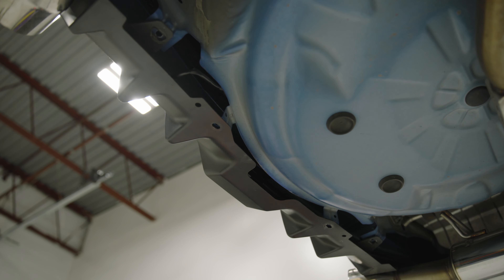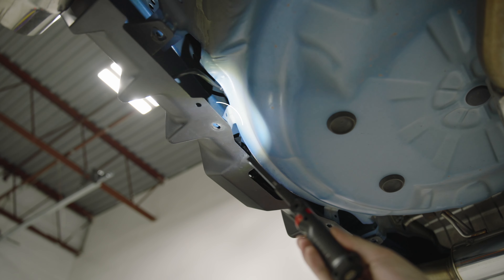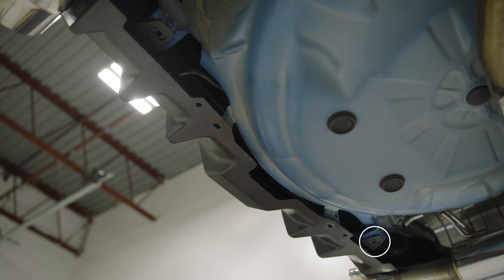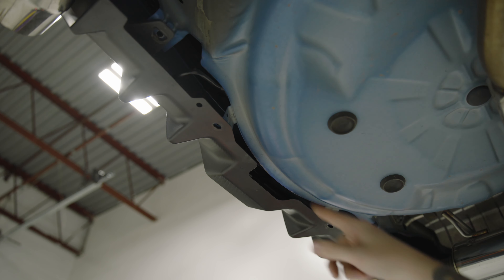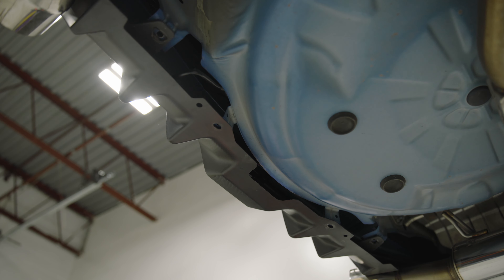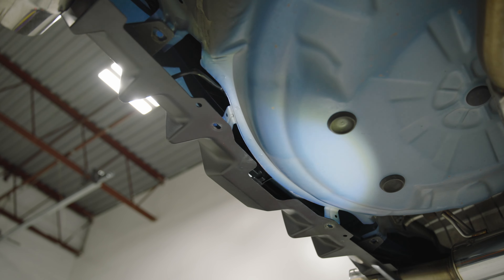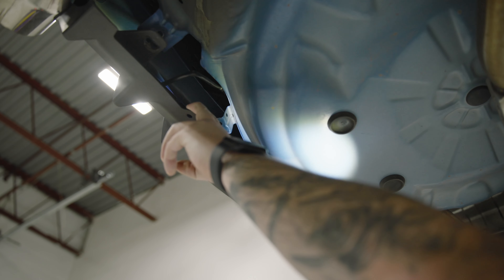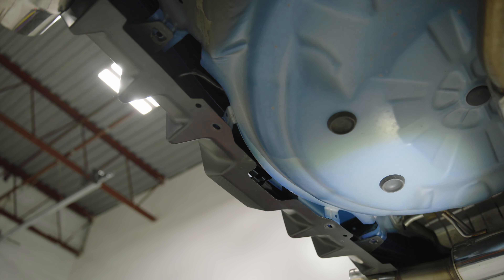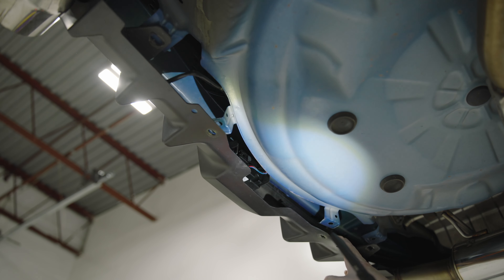Once you're underneath the car, here's a pro tip to help get the rear valance of the bumper out a little bit and give you some space to get your hands in. There are four push clips — you'll see one, another one, another one, and another one. These are likely some of the hardest clips to get out since they pick up all the dirt and grime. I'd recommend hitting them with a little WD-40 or some penetrating lubricant to ensure you don't break them. Once you have them all out, you'll have pretty much unrestricted access to the back of the bumper. Maybe have a friend or significant other help hold it, as it can get a little tight.